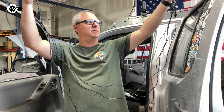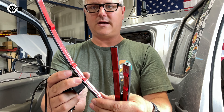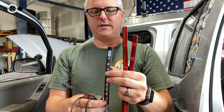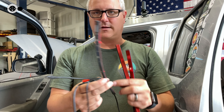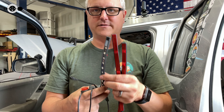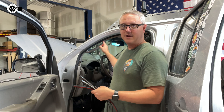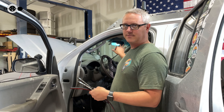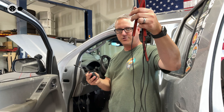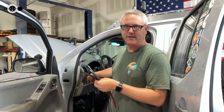You get pretty long wires — probably four or five feet — with four LED strips with adhesive already on the back. One tip: once you get these stuck where you want them, hit them with a heat gun really quick to make the tape more viscous so it sticks better, and make sure you clean the surface really well. I'm going to attach two of these to the A-pillar to cast light out into the cab, and the other two underneath in the wheel well so I can see gear sitting on the floorboards.